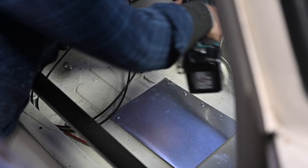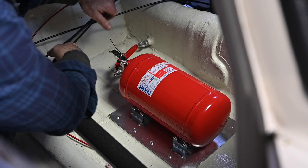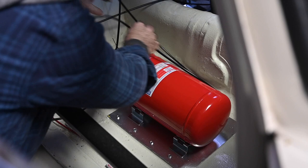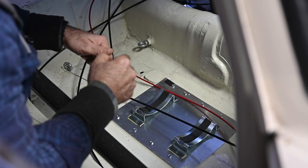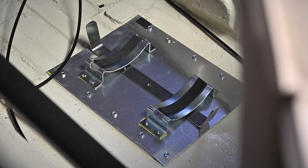Here's the bottle. I'm going to run it out this way, and the cables are coming in from this side. There's one more thing we need to put underneath, which is the anti-torpedo bar. This bar goes underneath the supports and prevents the bottle from flying back and forward — that's where it gets its name. I'm going to drill the holes in these brackets, mark the line to the anti-torpedo bar, and put a couple of bolts in to hold it in place.